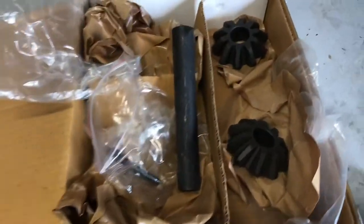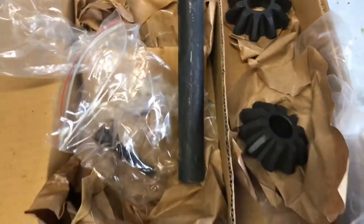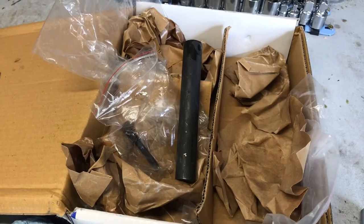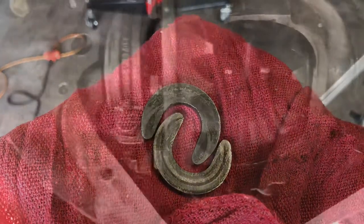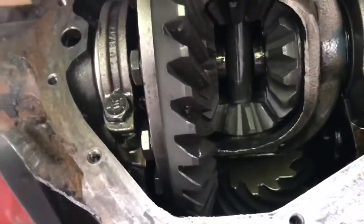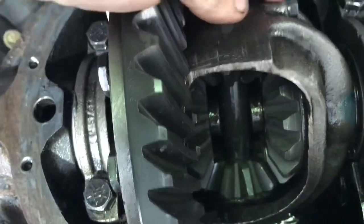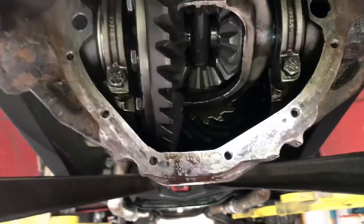The larger gears as well as the two smaller spider gears have new spacers — we'll put them in behind the gear, slide the pin in, and put the bolt in to hold it. That should have the gear part finished. We'll use the old clips that I took out — they'll go back in to hold the axles. Got the stock gears back in, got the pin back in, the center, and the bolt back in. Just need to tighten it up, then we'll be ready for the cover.